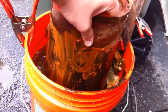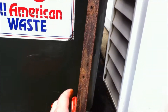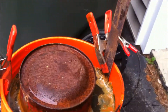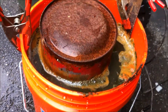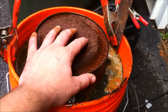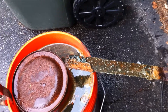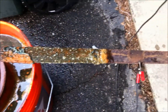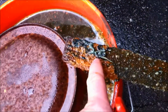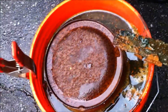I'll show you guys what I had set up. I had it clamped onto the side, and I have this piece of metal which was actually a wear strip off a 48-inch plow. Had it brewing in this bucket overnight and it worked pretty awesome. I really need a bigger Rubbermaid or something so I can get the end in there. You can see all of the crap that it sucked onto my sacrificial anode — all this rusty crap was all on that tank and it all comes over there. It's really neat how this works.